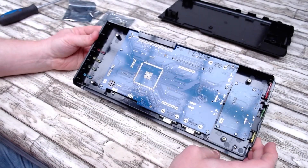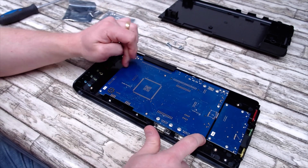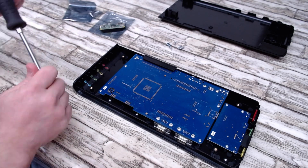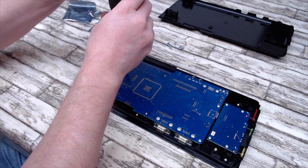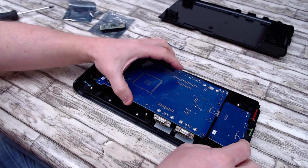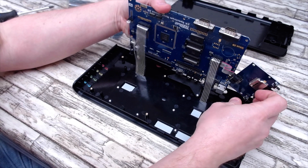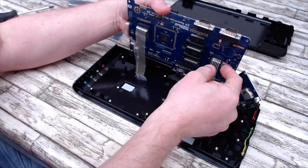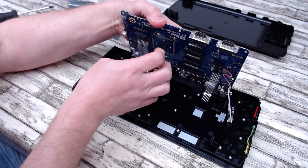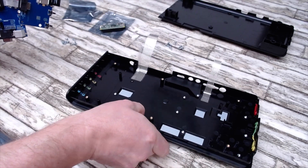Now we're left with the board exposed. There are four screws on the main motherboard and four screws on the daughter board, so we'll get to removing those. Once that's done the motherboard will lift up - the daughter board is attached by a ribbon cable. Be careful not to just yank it straight out because your keyboard is connected by some rather thin connectors. Those just need to be given a firm pull, and then the board can be put to one side.